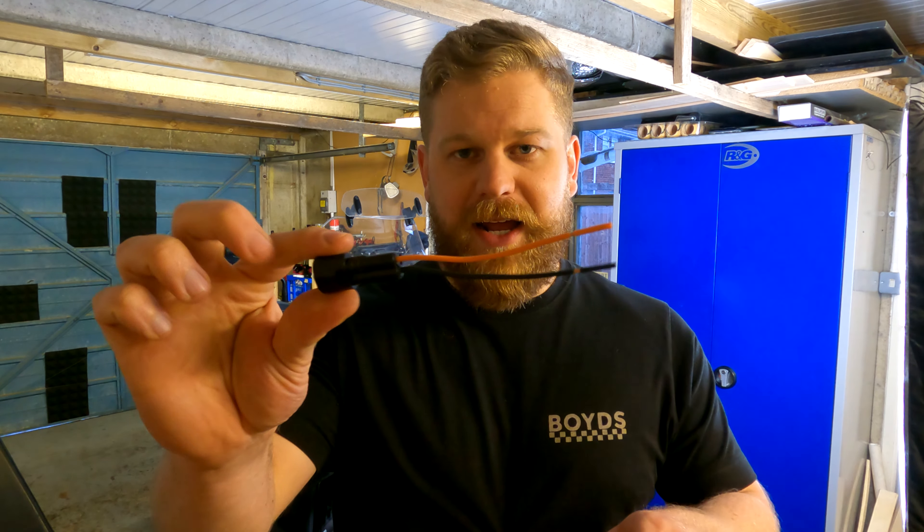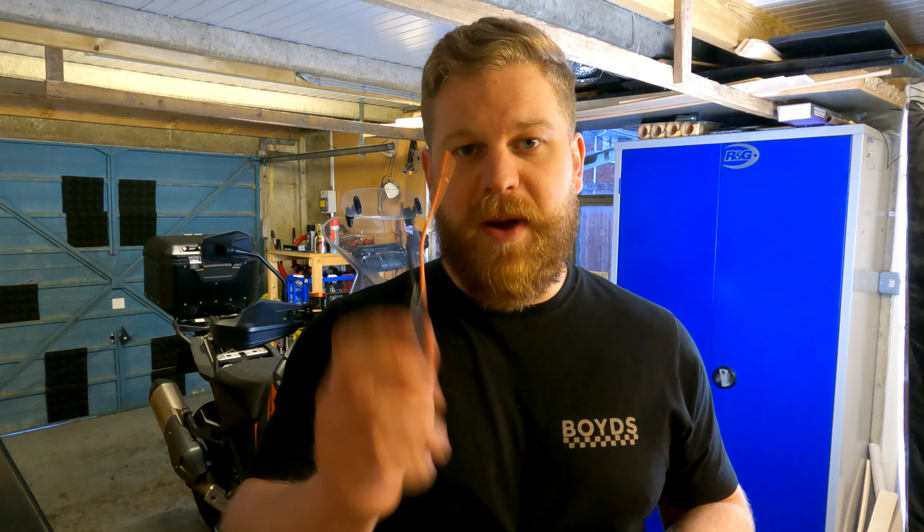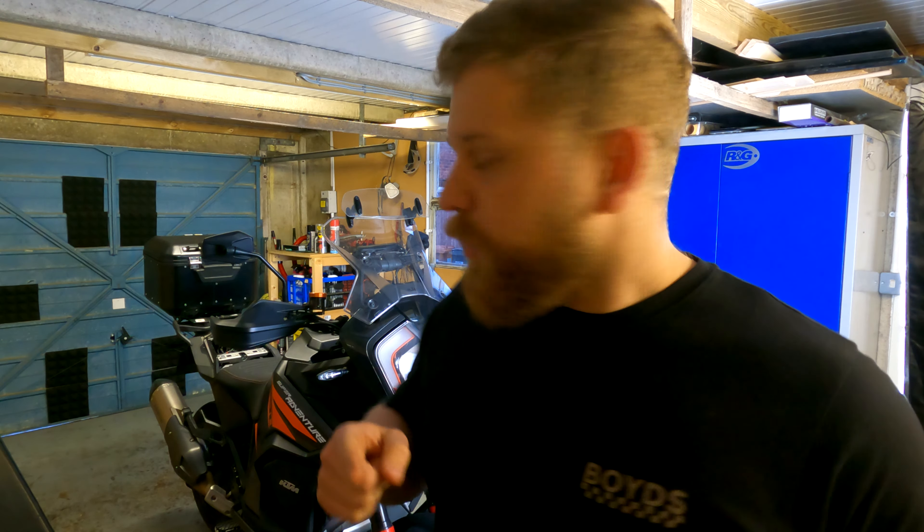But I was met with a thousand and one comments like, 'Why didn't you wire it into the accessory ports? Why didn't you wire it into the Hex Easy Can?' In the Hex Easy Can box you get a load of two-prong connectors which connect to the Hex's spare ports. You just solder those onto the battery terminal connections on the Garmin's power lead. The reason I went to the Hex rather than the accessory ports up front is because I'd already run the wire to the battery compartment. The Hex Easy Can also works as a switched live, so it'll only ever power up when the bike turns on.